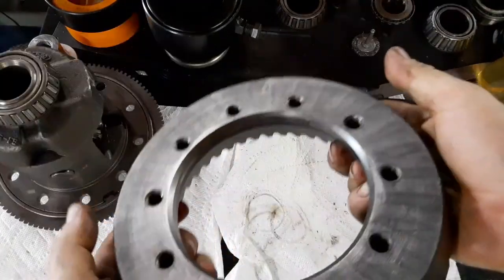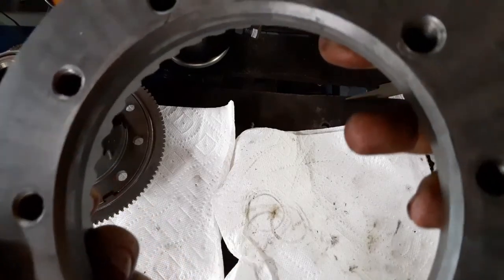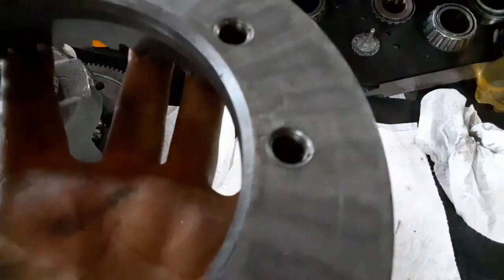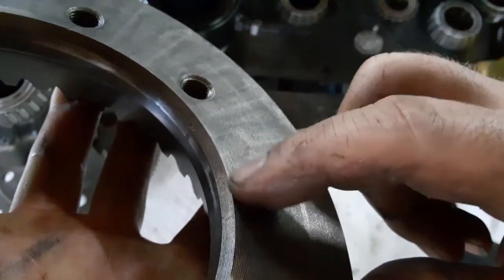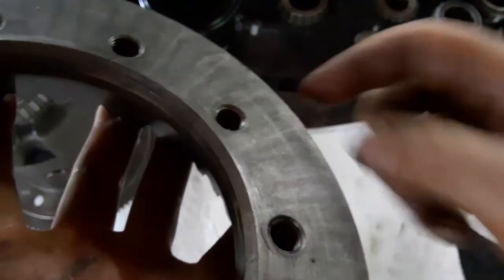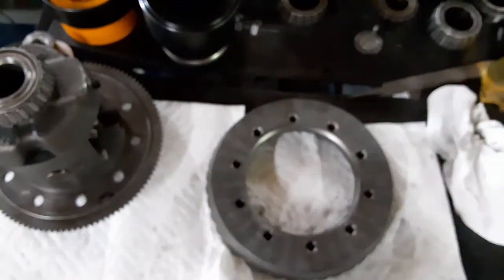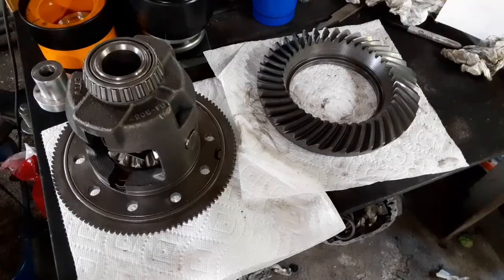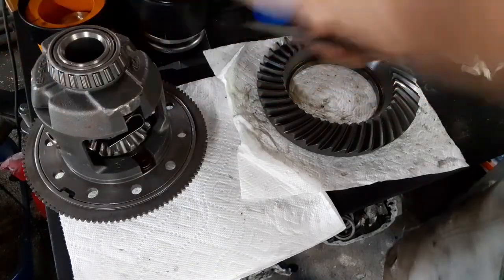Now I'll put the ring gear on. On the ring gear it's important to make sure that this surface is extremely clean and flat. Some of the items that can be damaged on it are these holes. If you look at this one right here you can see the edge is lifted up right at that bolt hole where it fractured a little bit. This ring gear is good - I'm not worried about the ring gear itself, but there's a little bit of a lip there that I need to file down. Somebody might have over-torqued it or when they installed this gear they might have pulled it on with that bolt, and it just damaged that thread a little. It's the only one like that, which is why I'm not too worried, but that's why it's a good idea to file this. Also take a smaller flat file and hit this edge right here just in case. Feels pretty good.